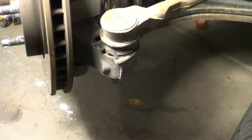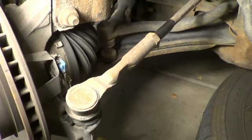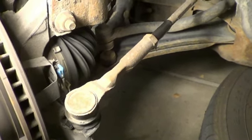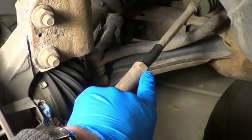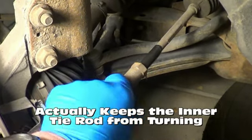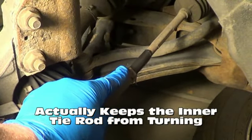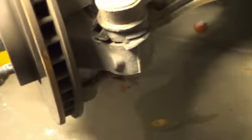Eventually we're going to have to do some smacking with a hammer. The replacement of this involves two basic steps. One, there's a nut right here that's basically a set nut — it keeps this thing from turning once it's in the proper position, so we've got to get that nut loose. Then there is a castle nut and a cotter pin. I don't see a cotter pin, but we'll get that nut loose.